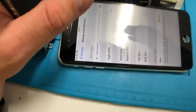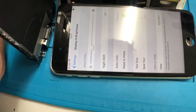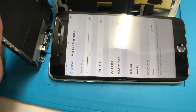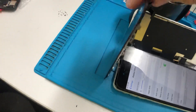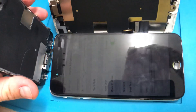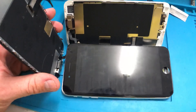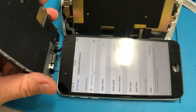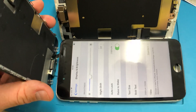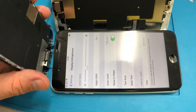So the point of this video is to show that even with original components, software features are disabled on the phone. At the moment the serial on the display can be rewritten. For the front camera flex, I haven't seen an EEPROM read/write solution — I don't know if it's encrypted — so if you're replacing the front camera sensor flex, the customer is losing True Tone on their device. I don't know what they're going to do in iOS 13 or iOS 14, but this has got progressively worse, and I think we should start talking about it before it continues to get worse. Cheers for watching.